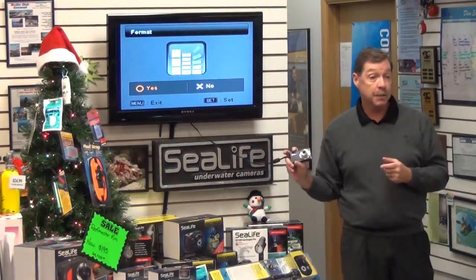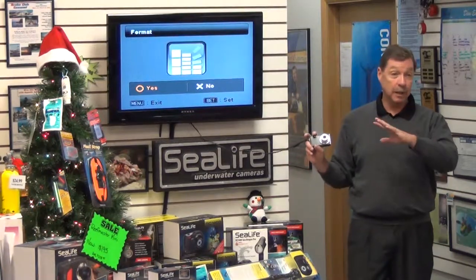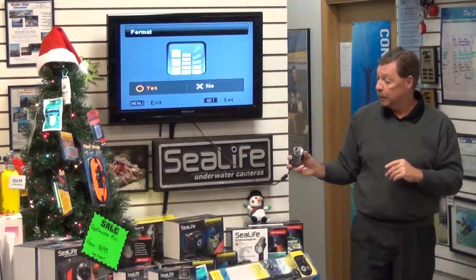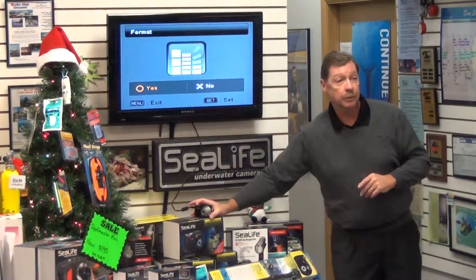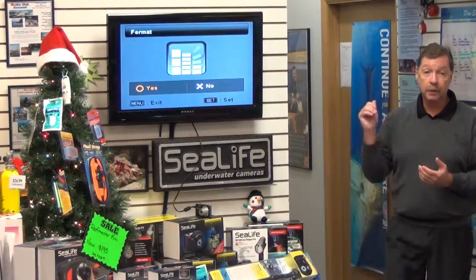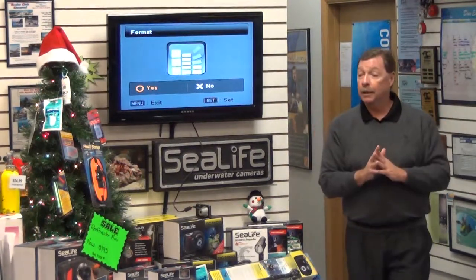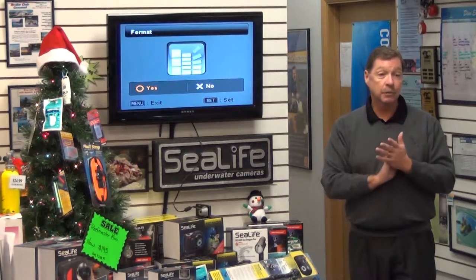Quite often, all of those pictures are left on the SD card. So it's taking up space on the SD card, it's making it write slower, limiting your capabilities with the card and everything else. So every once in a while, go back through and download your pictures. Back them up one more time, and then do a hard format on your card. Again, it's just going to erase everything on there. Make sure it is backed up, though, because if you don't, you will erase everything.